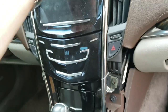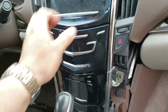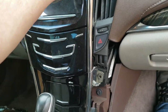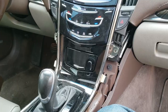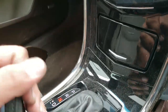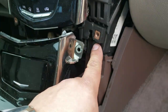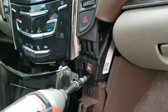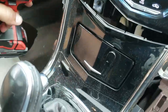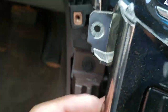Put that in a safe location. Now everything should come out forward - nice and gentle, you don't want to break anything. To make it easier, I threw this in neutral, turned it off, threw it back in drive. Now it's in drive and I'm able to pull this back out, giving me access to these screws here - they're also 7mm. So we're going to go ahead and remove these last screws and put those in a safe location.